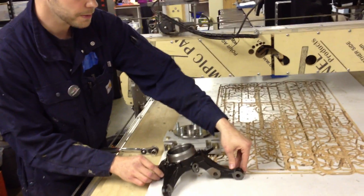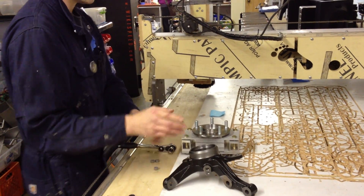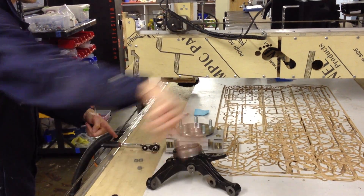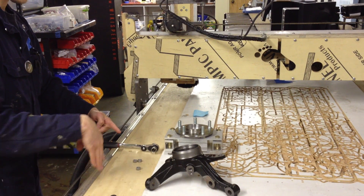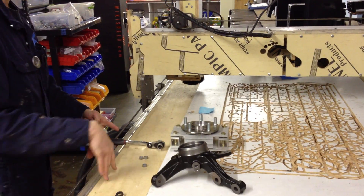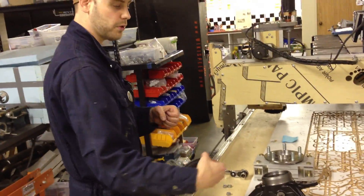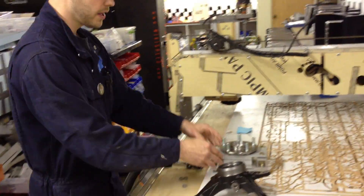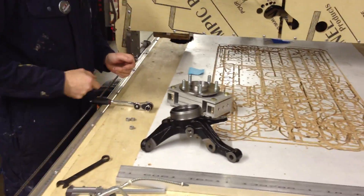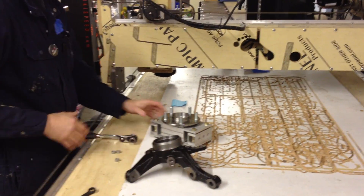Now caster angle — typically this would lean back if this is the front of the car and we're driving this way. What that means is the line on which it rotates: if the wheel's on this thing, here's the contact patch of the tire, here's the line at which we rotate. If the friction patch is behind the rotation line — just like casters on the front of a shopping cart — it will re-straighten as it drives. We could angle this whole thing back; that's the way a car typically does it, that's the way Honda does it. This has about seven degrees of caster in the 2006 Honda Civic.